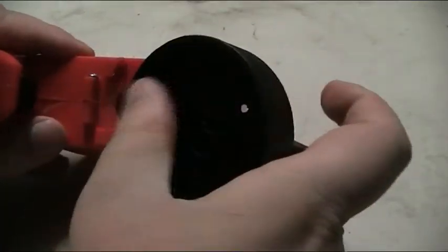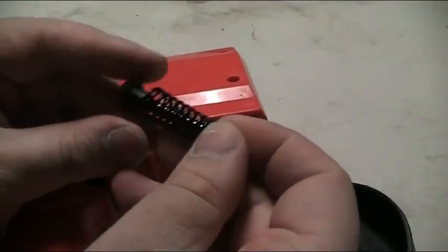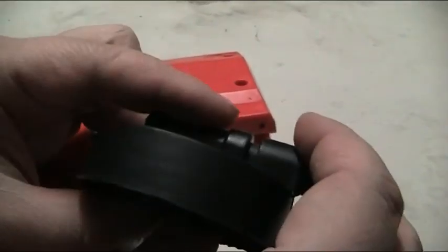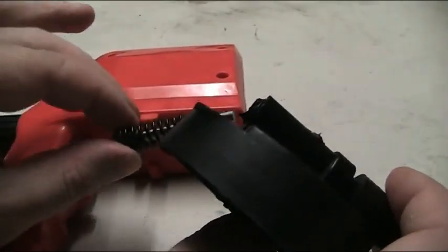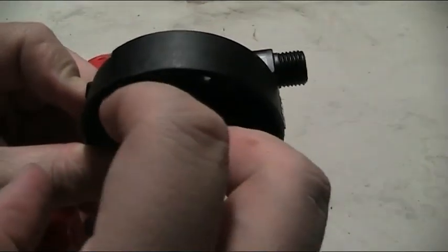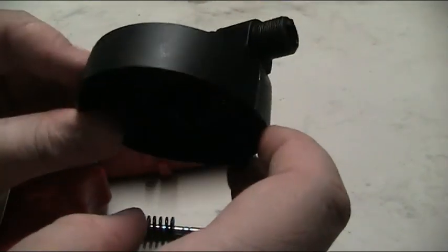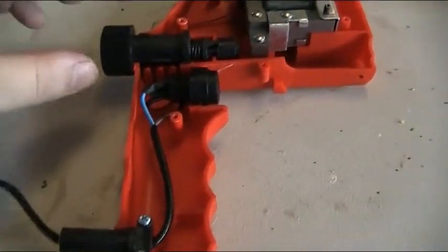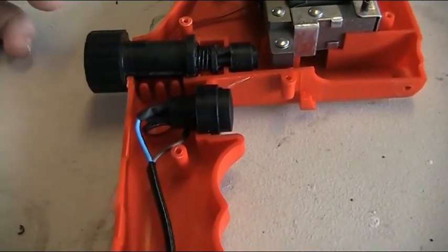The mechanism slides open. We have a piston rubber stopper, a large screw, and this end is the chamber. There is a mechanism that continually pumps, creating a vacuum in the jar and siphoning the paint to spray it through the nozzle. This is another mechanism that will be important to clean. Look inside — it's not necessary to open, but be careful as this mechanism can snap off.